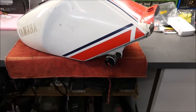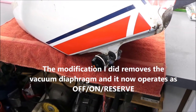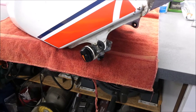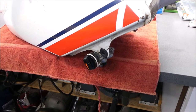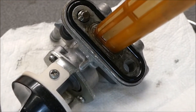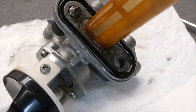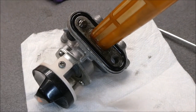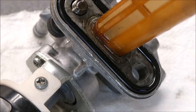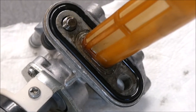Before I can get started, I forgot that last summer I did a fuel petcock modification to this thing. I'm going to pull it out and make sure that the epoxy hasn't degraded to the point where it's not usable. I've had gas sitting in here as pre-mix for five or six months. The fuel strainer that goes inside the tank was epoxied in - it looks like it's held up just fine. I dug into that epoxy with a scribe and it's hard as a rock still. I'll assume the internals are still good and proceed with the startup.